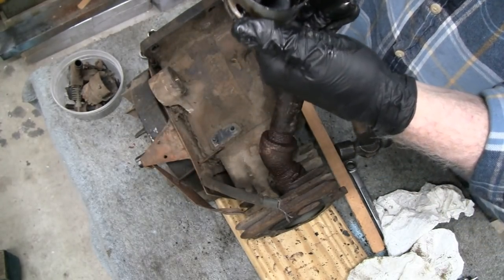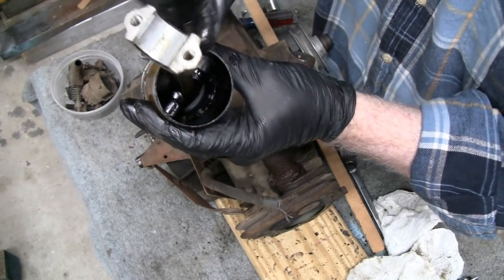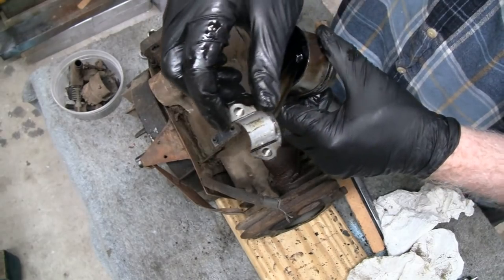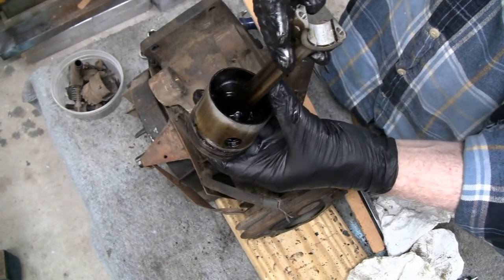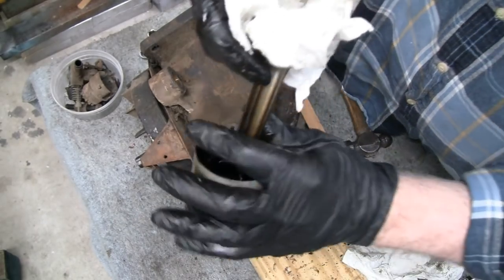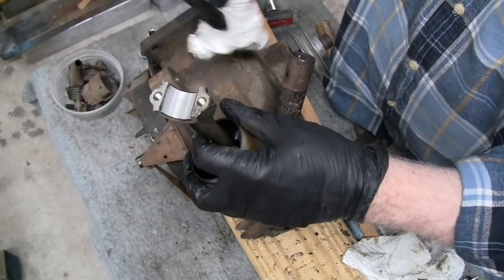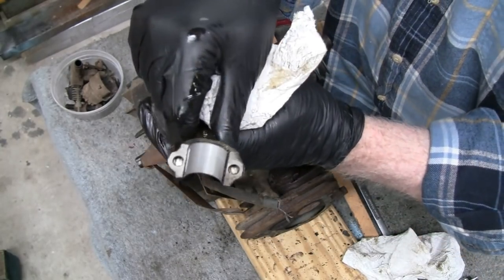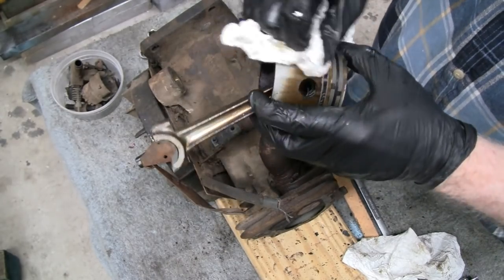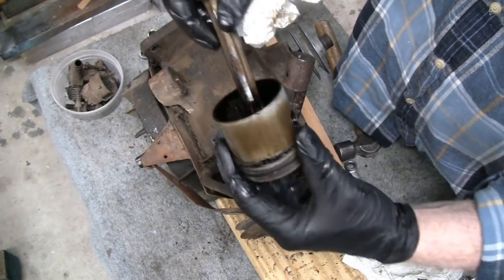I don't have to worry about how we put the piston back in because it has a little x on this side, and I think the x always goes to the flywheel. This is an aluminum connecting rod — pretty odd for 1934 — but that's pristine too. Beautiful. The piston looks good, no gouges or scrapes or anything, and it's tight as it can be.